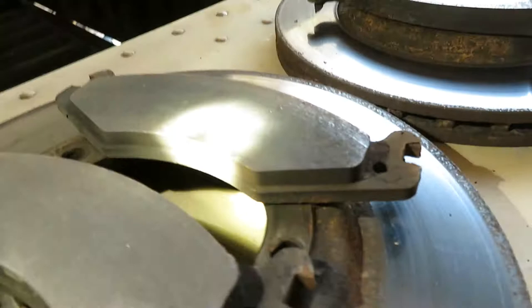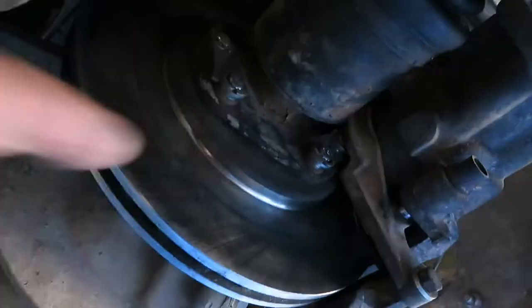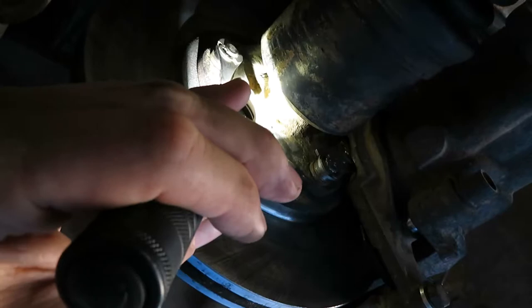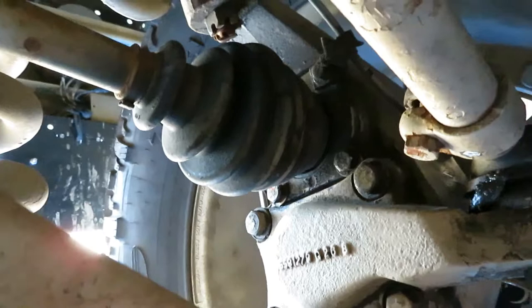Super super rusty with lots of chopping to it. I changed the rotors yesterday — climbed under here with a flashlight. I also did the locking mechanism from Blue Hummer, the safety mechanism on the bolts. Basically these six bolts come out — two here, two here, and two up on the top side. On the end of the half shaft on the outside there's a little cap that comes off. You can use your 3/8 drive extension with a ratchet and pull that cover out, then it's a 14-millimeter socket that takes that one bolt out on the very end of the half shaft.